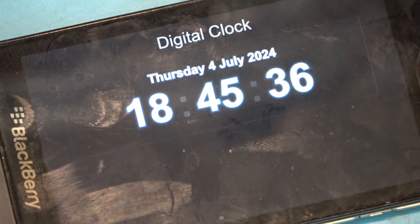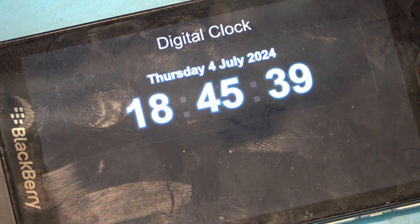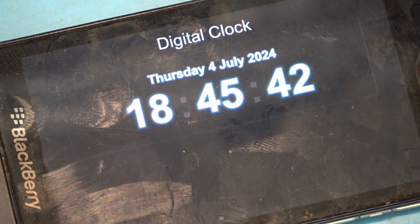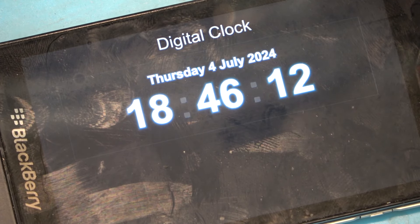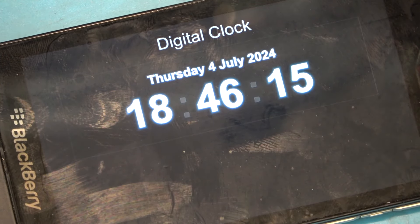The old PlayBook I showed you at the beginning — I've released the gas from the cells but I'm not going to plug it in. It'll turn on and run off power if I want to play around with it, but it's something I'm certainly not going to leave plugged in all the time. Once you have a lithium cell that's puffed up like that, can you trust it? It could catch fire — it probably won't because the flammable gas has been removed, and the BMS software should shut it down and monitor temperature. But why take a chance? I'm going to take the battery right out and run it without a battery — then there's absolutely no chance of any problem.